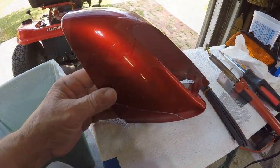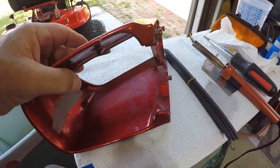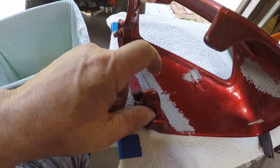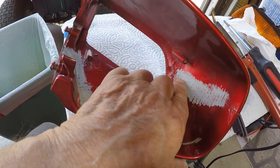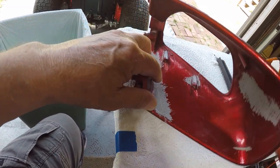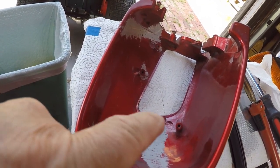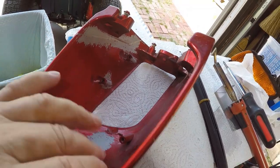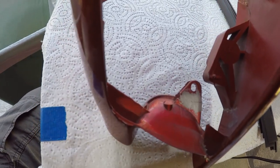To fix this, I started by gluing in the chunk that had broken off at the crack. Then I found that when I took the inner light out, a peg coming out was broke off — that one was broke off too. Here's the big one I fixed. I took one of those little metal ball attachments for the Dremel, with teeth on it, and went back and forth slowly so it would chew this up real good. There's a little tab right down in there where I put that little ball on it and chewed it where it's gray.